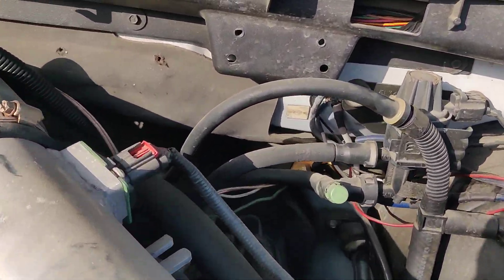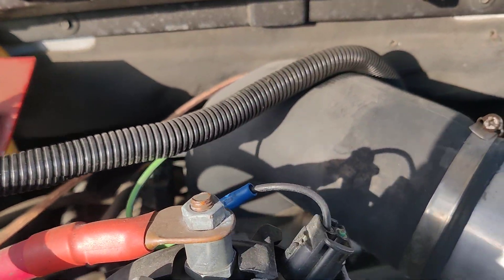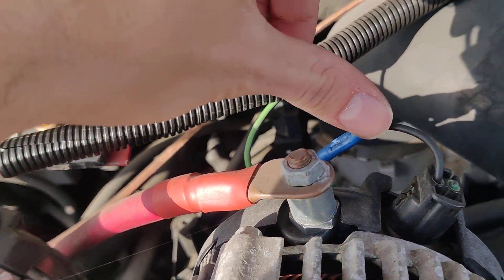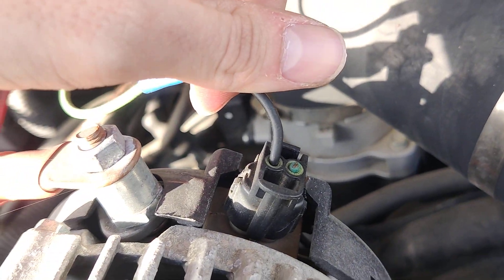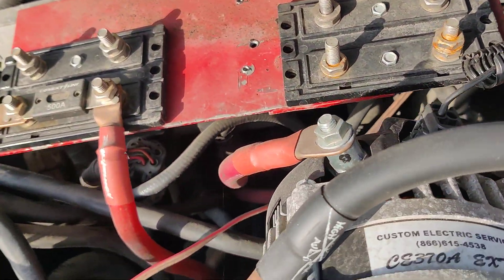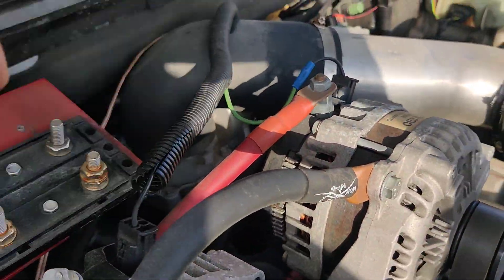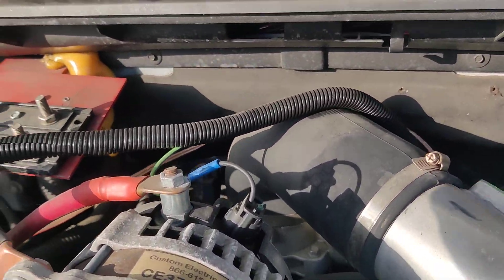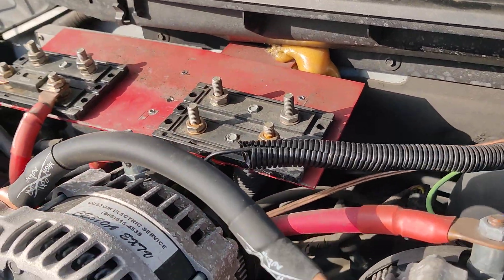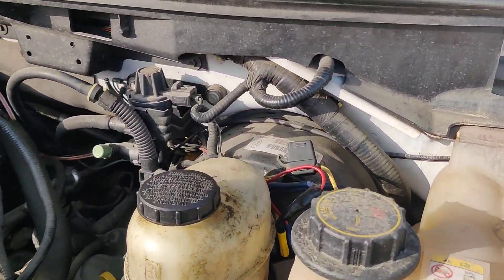The field wires — a lot of people are confused at what these are. As you can see, my green and white wire coming right over here, and here's where my field wire is. These are GM alts, and my field wire is connected right here on the plug. I have two plugs right here — it is that black plug right here, and the same for this other one. That's my white wire and that is my green wire. I know in the diagram it says you need a negative field wire, but all you need is the positive field — positive field — and that is what's going to turn your alternators on and let the regulator charge everything.